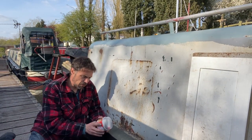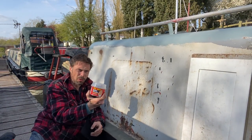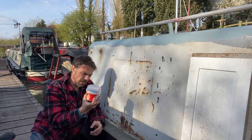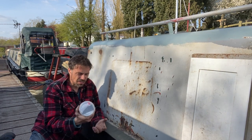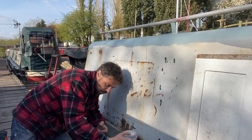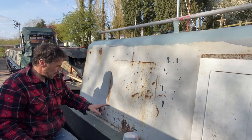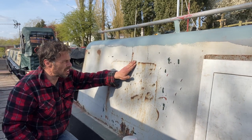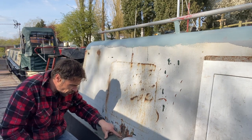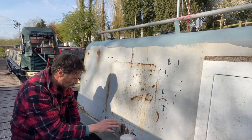This is the filler I've got — Big Boy body filler. It's come quite highly recommended. There's two different versions of this but I'm going to give this one a go, obviously, because I've got it. This is the area I need to pay some attention to, to sand down and get the rust off, because you can't put this on with any rust. So I need to clean into these areas here.